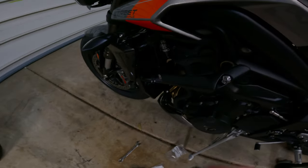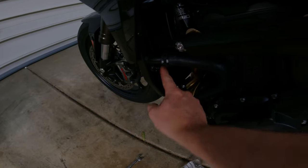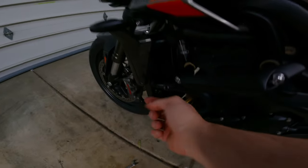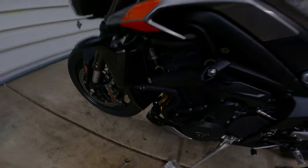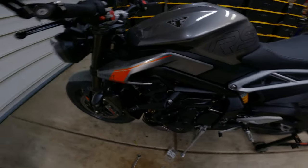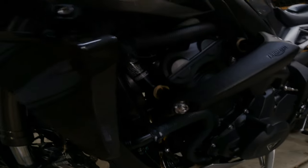And we're good. I had to undo this one and the one on the other side, loosen the top ones, and then I was able to pull the radiator fan back enough and the bolt just fell right out. No harm, no foul. Just a stupid little mistake. But just be careful when you're putting that back bolt in on the left side.